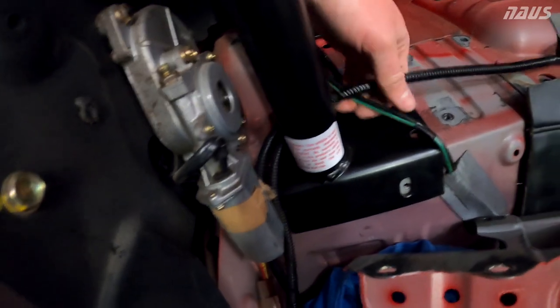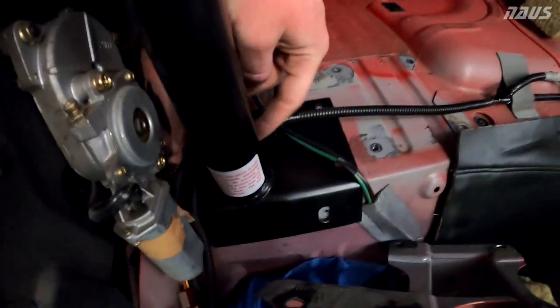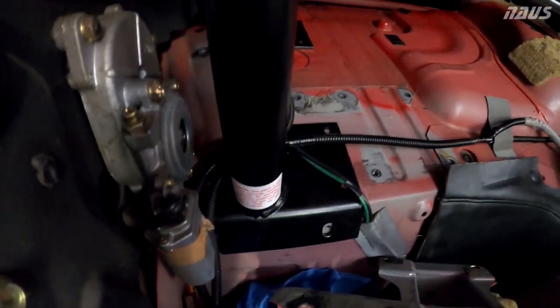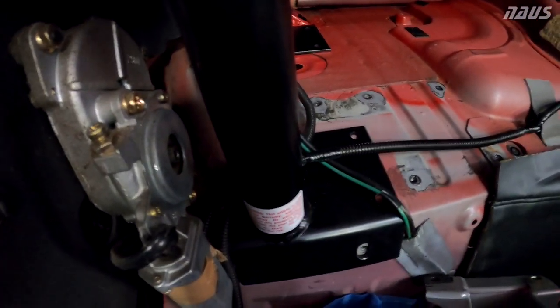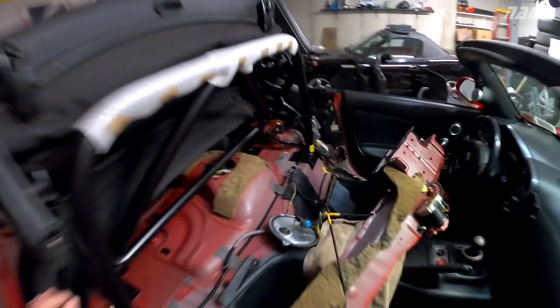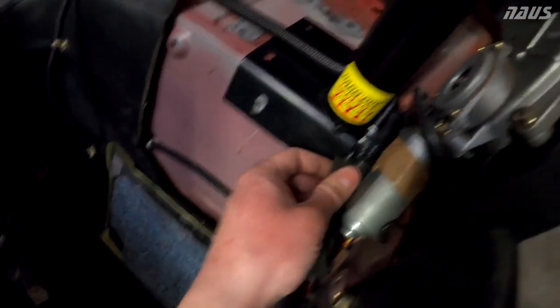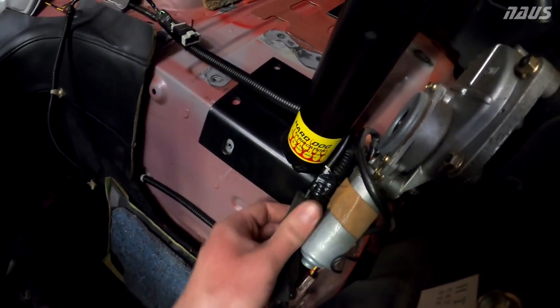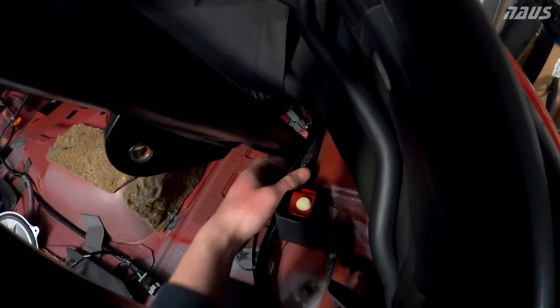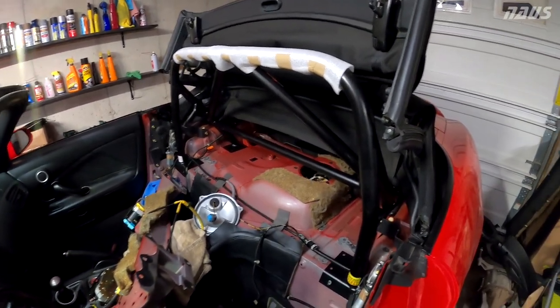I have all this running on top, and you can set the bar in, lift it with one hand, and work these back around. There's a clip that holds this one down to the frame right behind the roll bar — you've got to pop that from the frame before you put the roll bar in, so this is all loose. Kind of feed it behind. That one gets a little tight, but there's still a little bit of slack. The other side is pretty tight too. The plastic conduit the wires are in has a larger diameter on this side, so it definitely gets kind of pinched in this little area. I wiggled everything around to make sure nothing was getting pulled too tight. It is a little tight back here too by the roll bar, but all in all, I'd say it didn't go too bad. It's centered — I'm going to take a sharpie and mark my holes that I have to drill.